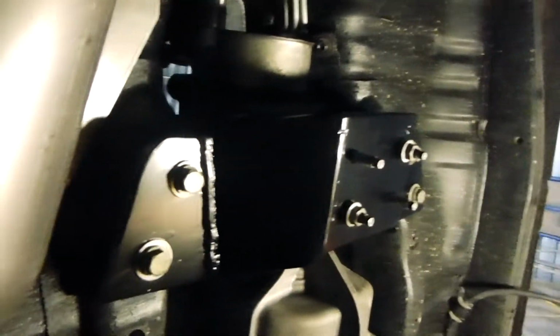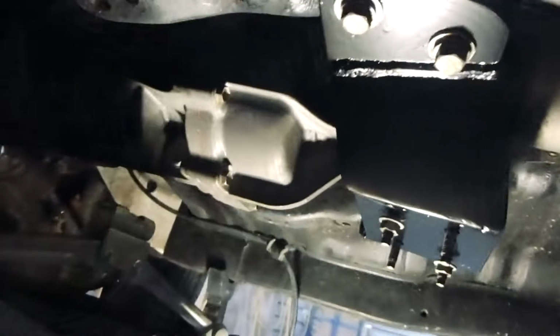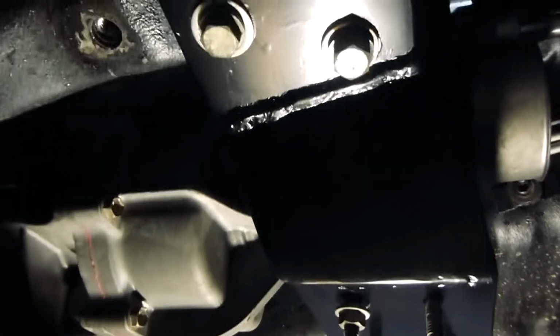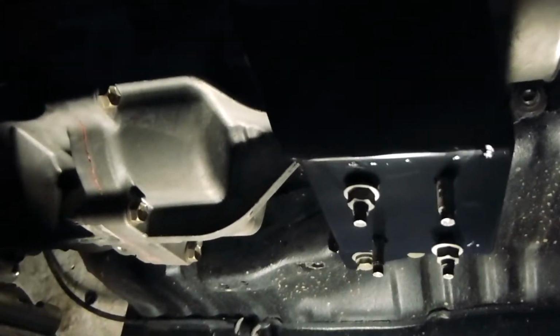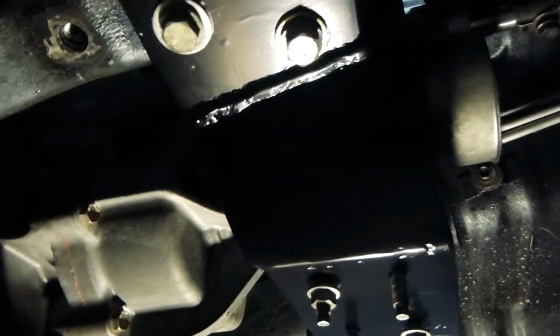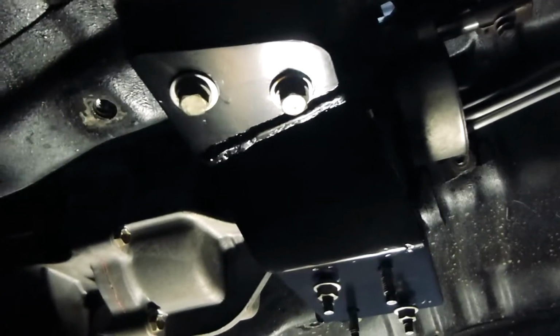So yesterday, Saturday, was an eventful day and we got the gearbox finally mounted pretty permanently. The full gearbox mount. Welded sections, so it's 1, 2, 3, 4, 5 sections, base plate, edges, and then the mounting plate onto the chassis, made from 95 by 8mm steel, so it's not going to go anywhere. Strong, it's built like a brick shit house.